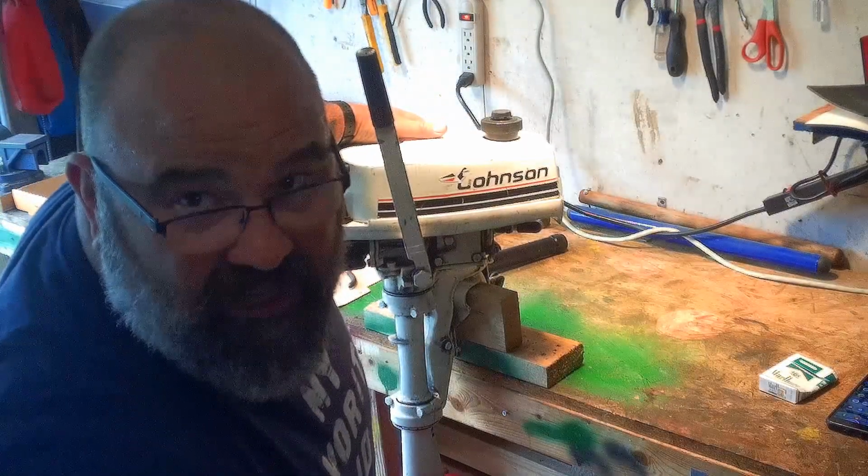Time to cuss. Got to dig a little deeper. All right, guys. Fiddled with it, and I got it figured out now anyway. The original float valve would not work with the new float valve. The threads were different on the seats, and it wouldn't sit just right. I took the new float valve and all that stuff out, put the old body back in, cleaned it up real good, put the needle valve or the little float valve back on top, put the new float back in, then it would travel up and down. Before, it was not coming down enough to let fuel fill the bowl. Got it figured out. Check this out.